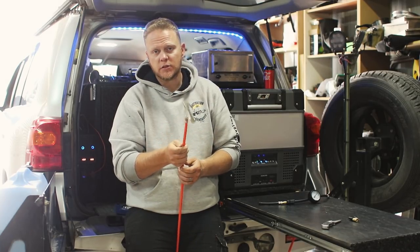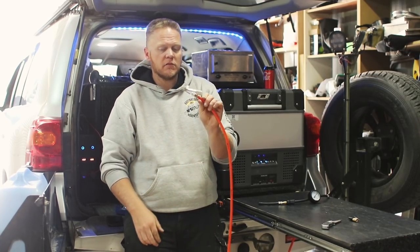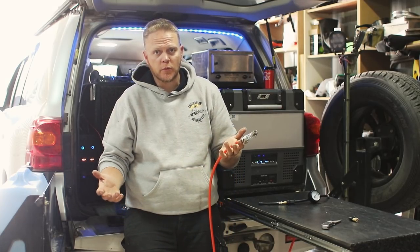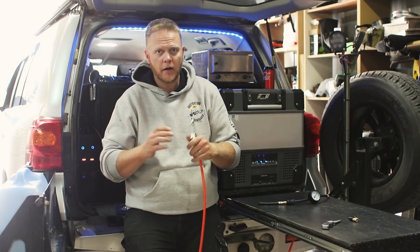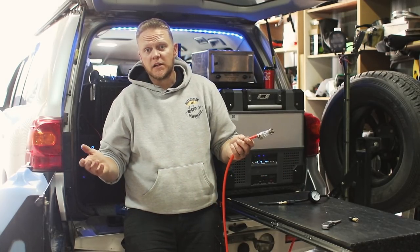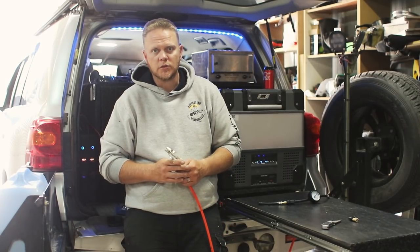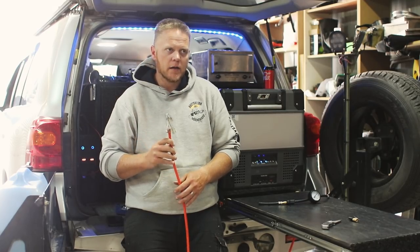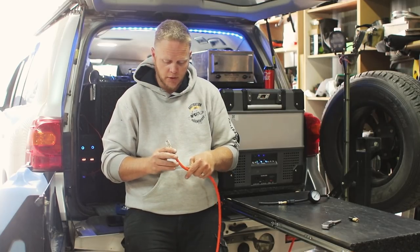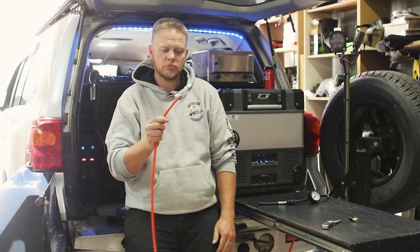So in answer to the question at the start of the video: can you double the speed of your compressor? Not quite — it doesn't quite double it, but it is pretty quick and it does help for sure. You're talking about 6 to 8 PSI difference over a minute and a half, so from dead flat up to 30 PSI with the ARB, that was a minute and a half — so probably two to two and a half minutes per tyre overall. Yes, the Kings one is slightly quicker, but the Kings one also half broke while it was there — half the hose bloody melted off again. I had to fix that. Bloody Kings stuff.